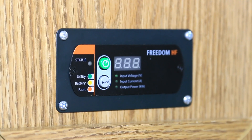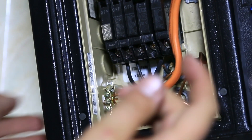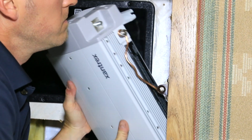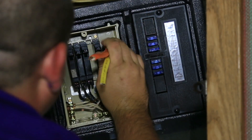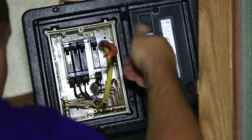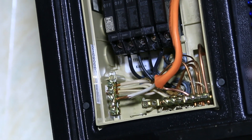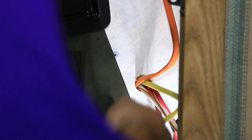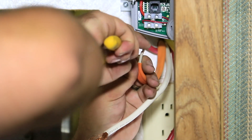Once the installation of the remote control panel is complete, we're ready to move into making the connections for AC and DC of the inverter, as well as mounting it in the location where the original converter was. In this step, we are completing our AC connections. From the circuit breaker, we're going to feed a 10-gauge Romex to the inverter. We're then going to run a 14-gauge Romex from the inverter back to feed the circuit, which would be the appliances and the receptacles. Now that we've completed running our wiring from the breaker panel to the opening where we'll mount the inverter, we get the Romex prepared, stripped, and ready to install.